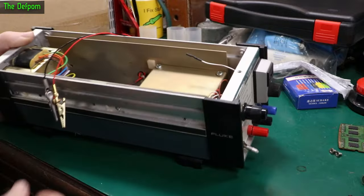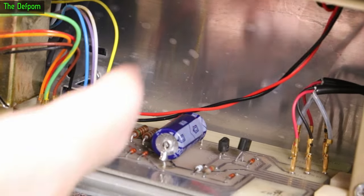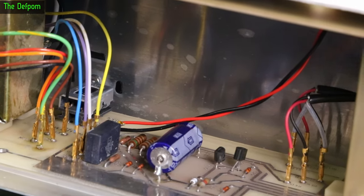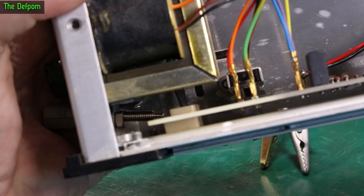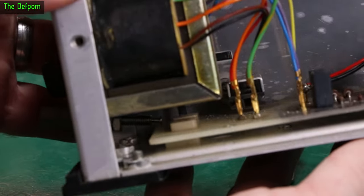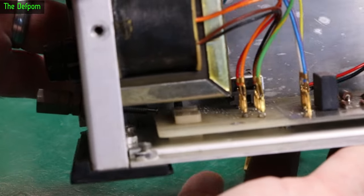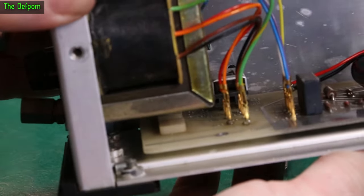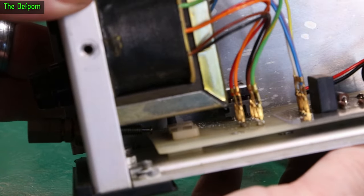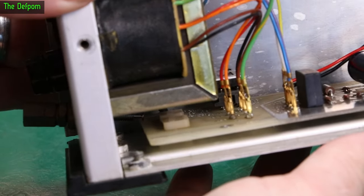So what's been done is extensions have been put on here for the battery, so it runs with an external battery instead of having an internal battery. There's a switch at the back for voltage — I'll flick that, change the voltage to make sure it's suitable for my country, then plug it in and try it out. That thing on the back has pushed this post over — you can see the end of the post is touching the circuit board, which is probably what stopped it going further. I need to check it's not touching any traces, because that's an earth pin. If it's touching near the main stuff, we might have a problem — could go bang.